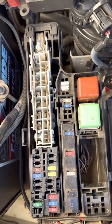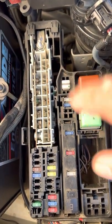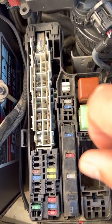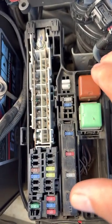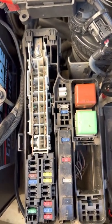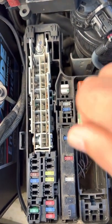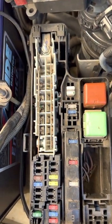I hope this has helped. If you have the same symptoms — no lights on the dashboard at all when you turn the key, plenty of power in the battery, you've hit the starter motor a few times and there's no cranking, no sound, it's just completely dead — it's a fuse problem. Thanks for watching.